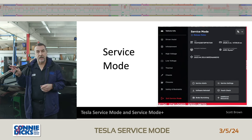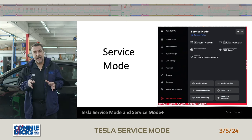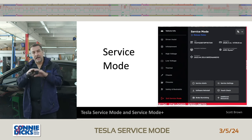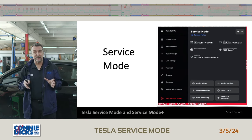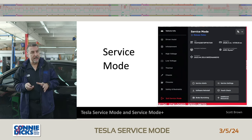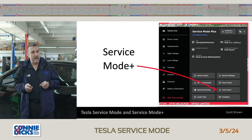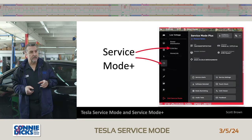There are some tools here for the camera pitch aim function, which needs to be carried out whenever you change out the windshield or change out the camera. You used to have to have the toolbox application — it was a tedious process where you would request the car to take a picture of an image with a target out in front of the vehicle, see the measurements, go back and adjust, and repeat. Very time consuming and it didn't always work. Tesla just brought this right to the screen, and it doesn't cost anything. In service mode plus, you'll see some additional things activate, including a CAN viewer and a new CAN bus panel.